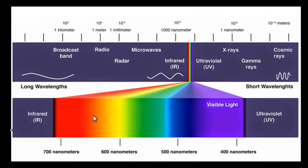The reason I chose a red LED light over white is because white LED light shows all the visible light. The brake light has a red filter, and that red filter is going to filter out all that light and only let the red light through. Since it's already red, it should be brighter.